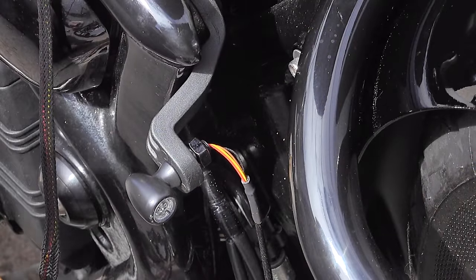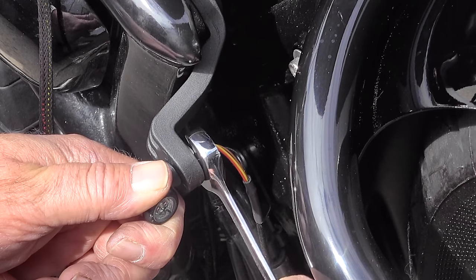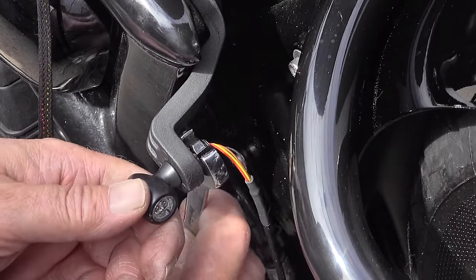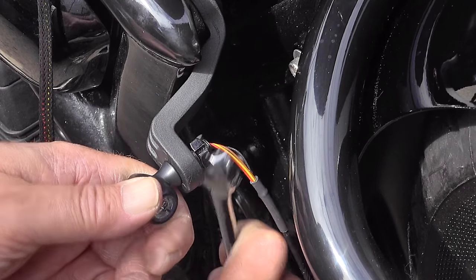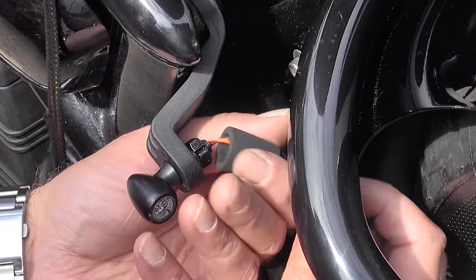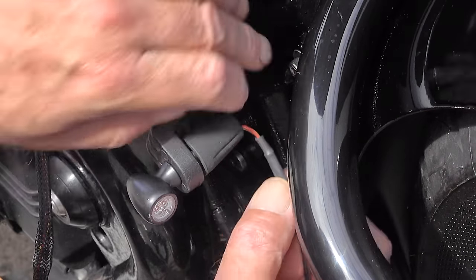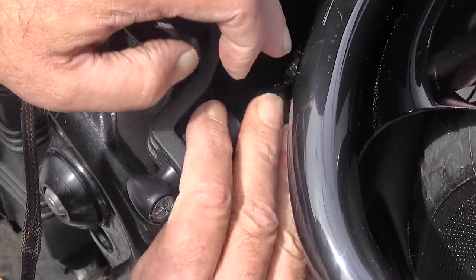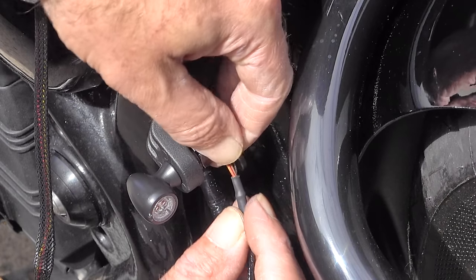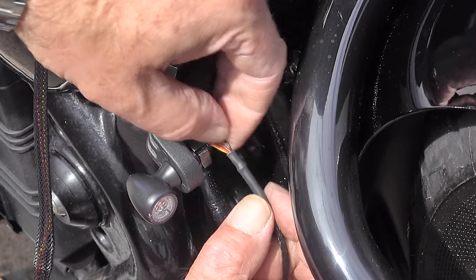Fasten up that bolt with a 13 millimeter open spanner. Tighten to a sensible level — don't put too much pressure on it. You've got a steel threaded shank going into a precision die-cast aluminium body, and if you over-tighten you could strip it. It's just a tiny indicator assembly at the end of the day. Make sure you pull that insulation back up so the insulated sleeve fits well into your rubber boot, forming an effective seal against the weather.